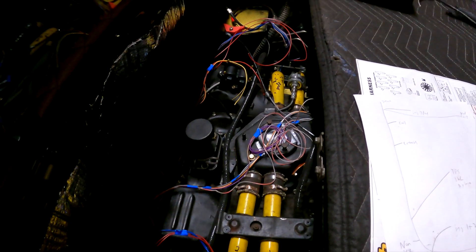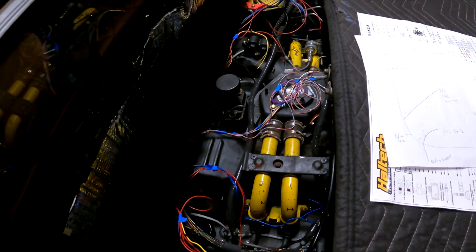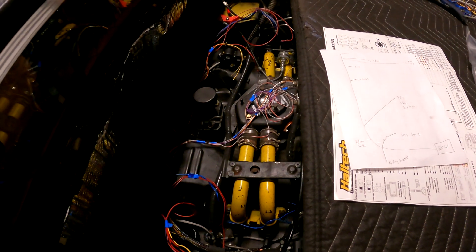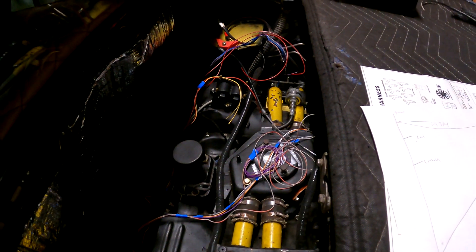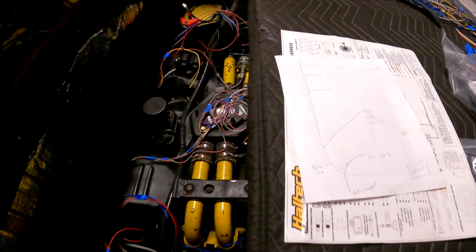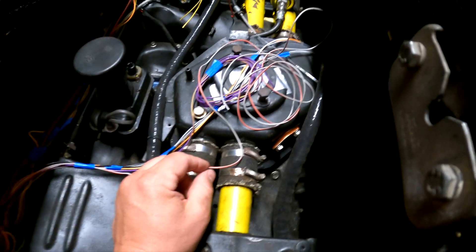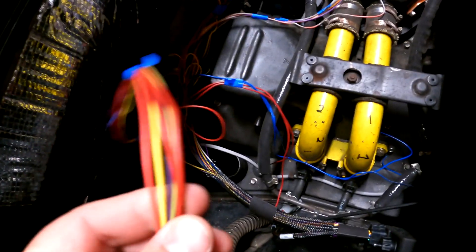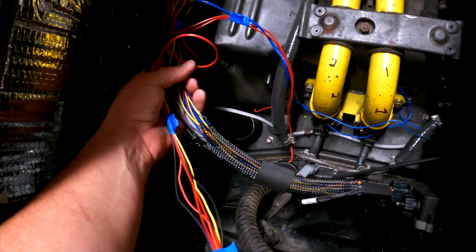After visiting four parts stores, I got some wire. I've added power for a couple of things not powered by the ECU — you need to supply 12-volt switched power to each injector, all four, and 12-volt switched power to your coil. I'm also going to use an idle air control stepper motor, and I'll use one of the gray and red keyed powers off the ECU since the amp draw isn't too high. I've put that into the harness — the power for those two things will come off some relays in the back, joining the harness at the first junction.